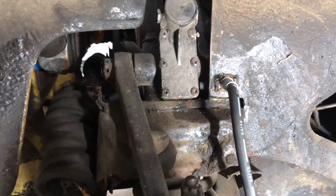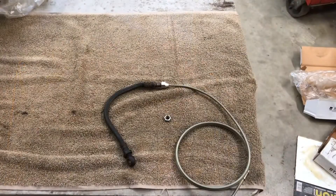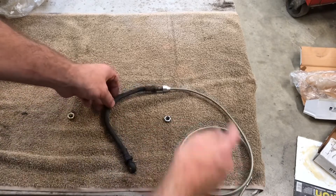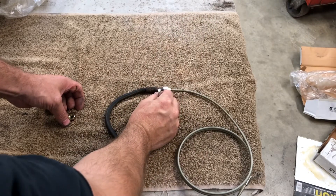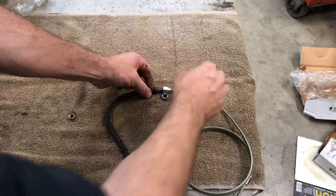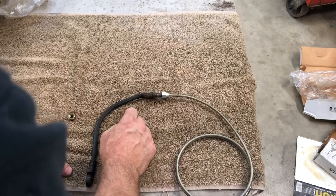Let me go to the table here to show you. This is how the hose is set up when you have the brake line hooked to it. Originally there's supposed to be what they call a jam nut that bolts this to the inner fender well — that would give me this much room to loosen that nut off, get this out of the little holding tabs, so I could spin this and hold it while spinning this out of the tube nut on the end of the line.